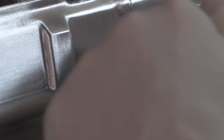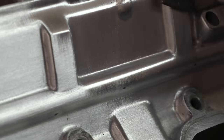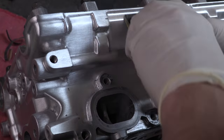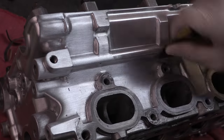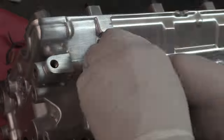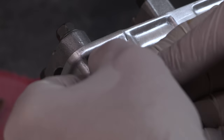You can still cross plane it with the same grit to flatten it out if it's not quite right, but if you can see it and haven't started on step 3 on this side yet, go back and do it with 180 grit instead — save yourself a few hours. The reason why is because 220 grit is where you should dig out all of the fine details and transitions. It's where you define the shape of all the flat areas coming together, and you start to establish a smoother texture instead of a rough, hewn, scratched-up looking surface. You'll watch the shine and color of the aluminum start to pop out more by the time you've finished.